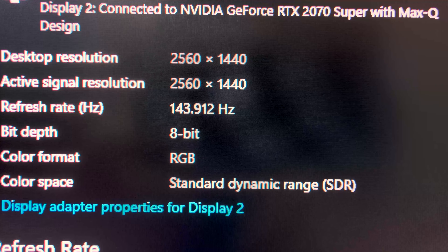I just want to go over how you can change the Hz on your display — it's very important if you have any type of monitor that's not a 60Hz default. You've got to go to your settings, look in Advanced Display Settings, and it would probably be at 60. Make sure you turn it all the way up to the maximum. Another thing I noticed: the monitor offered me the ability to display at 2160p. I went ahead and turned it up to 2160p, which seemed kind of strange for a Quad HD monitor, but it does some kind of simulation of what it would look like and it looks a lot clearer. So you can either use the 2160p mode or change it to 144Hz — both ways it looks a lot sharper.